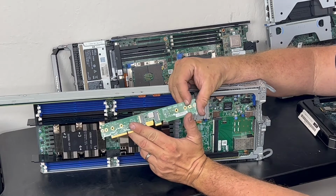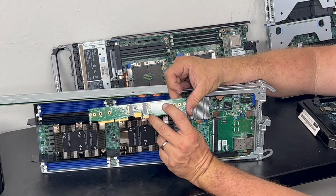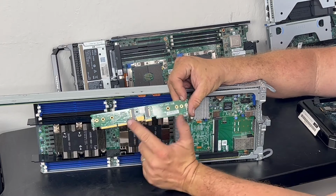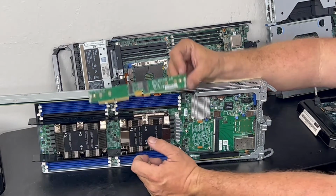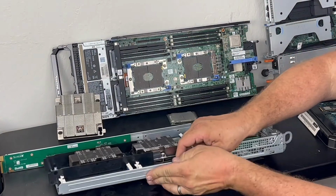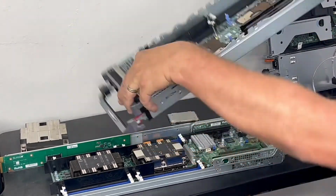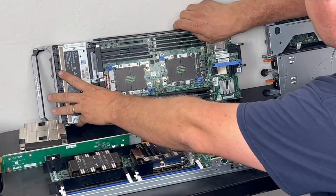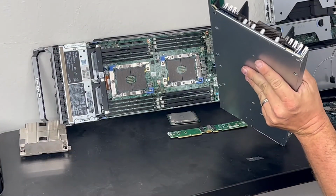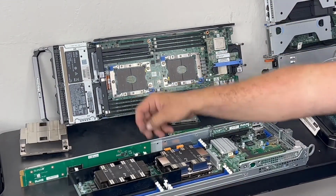And of course, it's real simple stuff. They put BPN, backplane adapter, ADP adapter, to M.2, 1U. So this is for a 1U blade for 2 M.2. And you can see the little differences. The Supermicro just uses simple folded steel. Dell manufactures over at Quanta, so they have these complicated rails on everything that they would do for their blades, and a complicated connector, whereas Supermicro just has everything going to the hard drives here, and then the power comes in through a simple edge connector right there too.